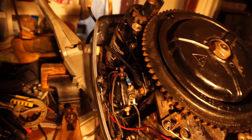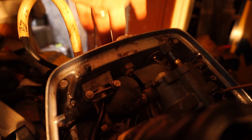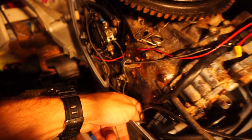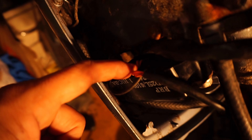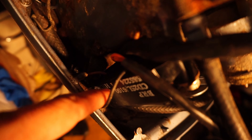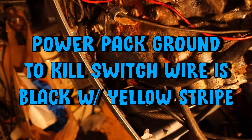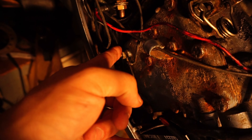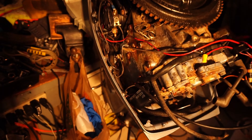We hooked up our kill switch wires. The kill switch runs to the coil. We had to modify the coil pack because there's a couple extra wires I didn't know about. You got the two for the coils, and then you got the ground which goes right to the block. One kill switch wire goes right to the coil pack. The other kill switch wire goes right to ground — I grounded my solenoid and my kill switch to the same bolt here.